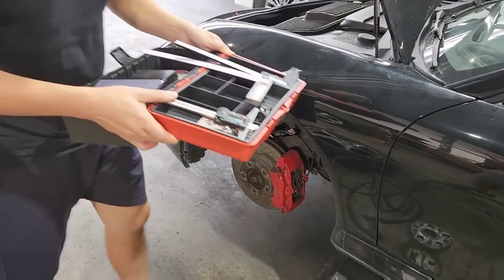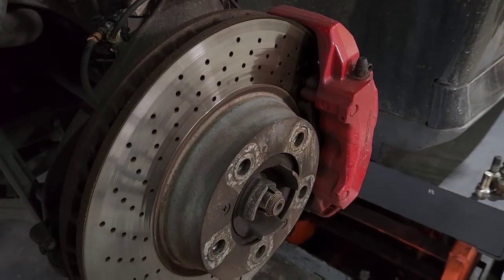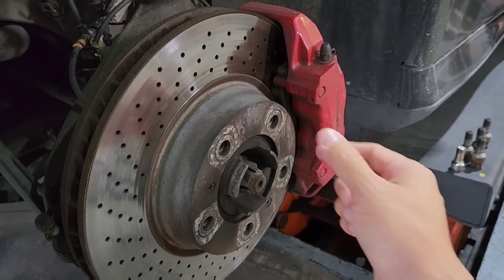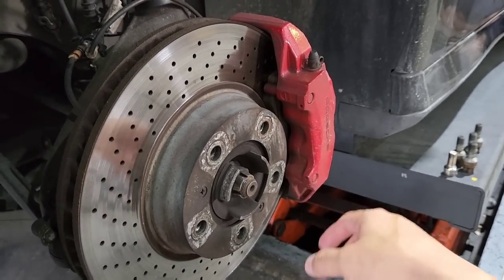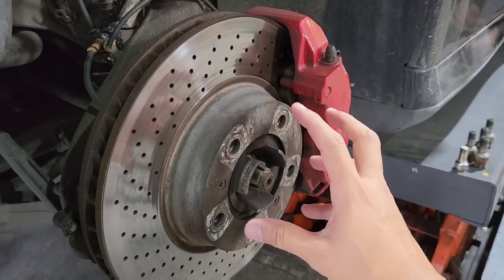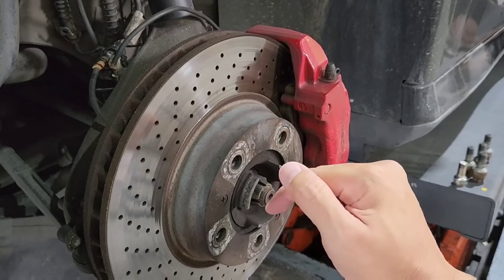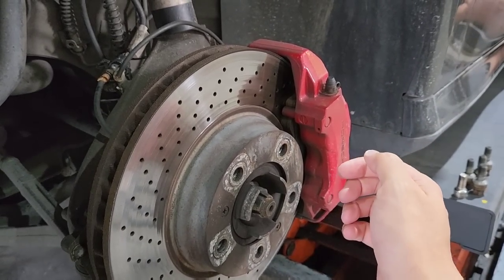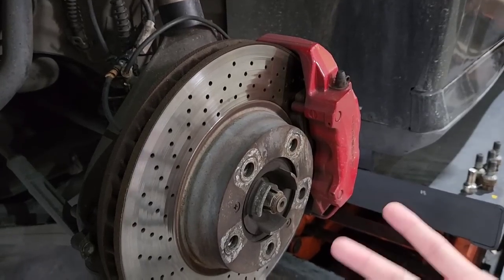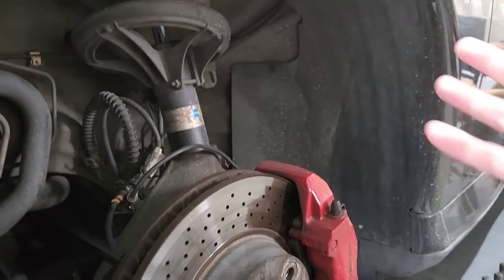For those who don't understand, like me, I don't understand wheels, the hub, the bore and all that, because I don't modify cars. So he has to measure the clearance for the calipers, and then the bore, and then the hub, the thickness, to get an actual measurement so that the wheel sits perfectly. A lot of aftermarket wheels don't customize bores. Basically, they have a universal bore, and when you apply it to different cars, they have to either drill the bore or use a replacement. You want to minimize all those layers so you have a wheel that directly fits onto your car. The clearance must be right so that it doesn't scrub.